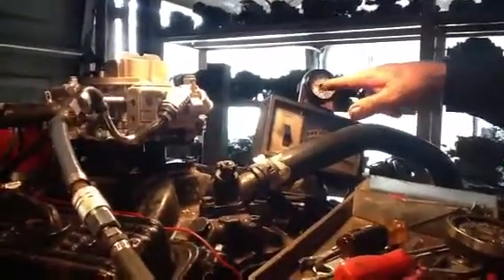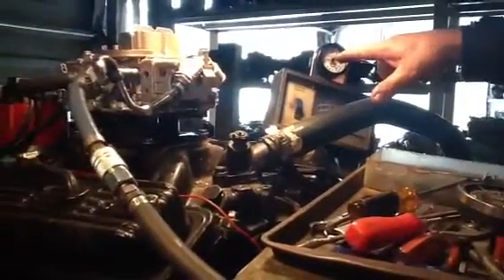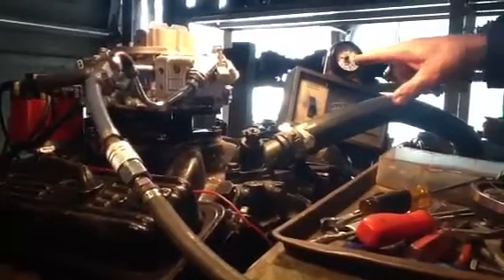Watch what happens when they kick it up. We're going to put it in a different pump in a different system. Go ahead and switch it. Watch the engine die. There she goes. Too much fuel pressure — for all you know-it-all mechanics who say that it doesn't affect them, look at what it did right there. It richens up that mixture all the way from 12 parts to 1 down to 10 parts to 1.